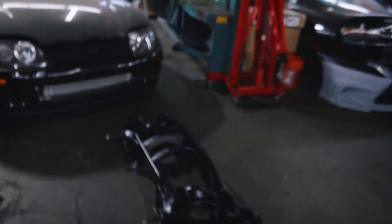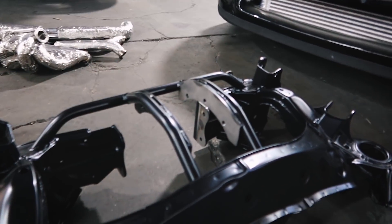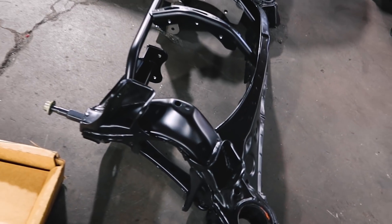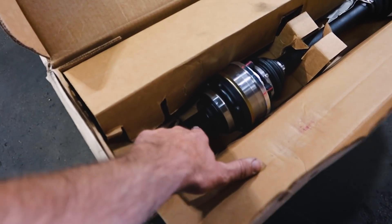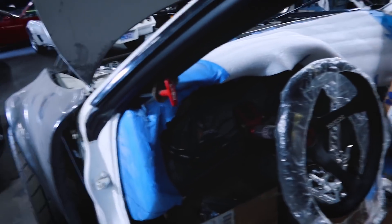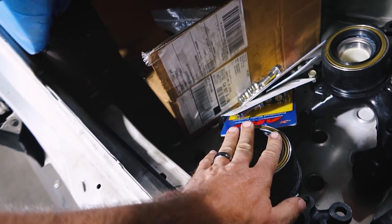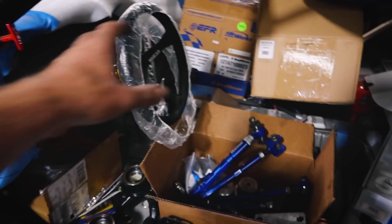It'll look similar to my Supra I guess. So upgrades he changed while we weren't working on it: he had us take the rear subframe out, then we built a little cradle in there to hold the Winter's quick change - so we upgraded to a Winter's quick change, and it's just fresh back from powder coat. We have to repress the solid bushings in there and then throw it back up inside. He also has the pro level axle kit with better outer hubs with 33 spline hub inserts - basically the biggest setup they make at Drive Shaft Shop, supposedly good for over 1,400 horsepower. We already pressed the studs into the hubs, now we just have to press the hubs into the knuckles, and we have these knuckles with new bearings.